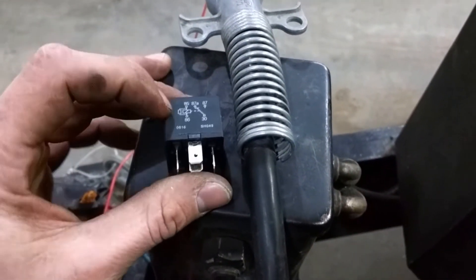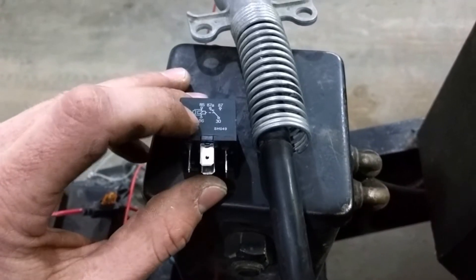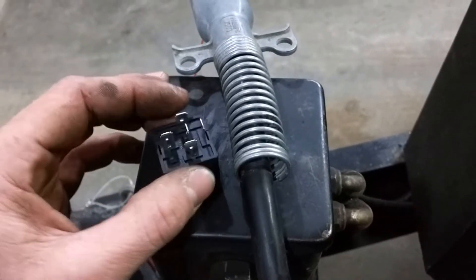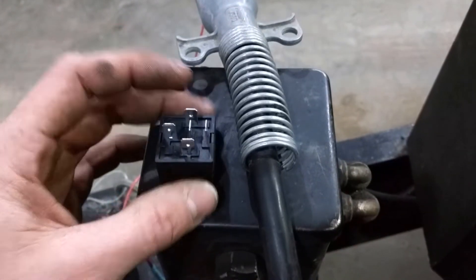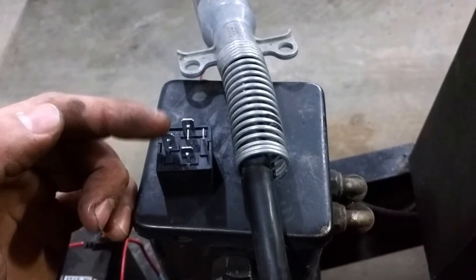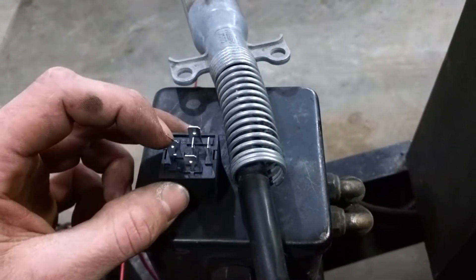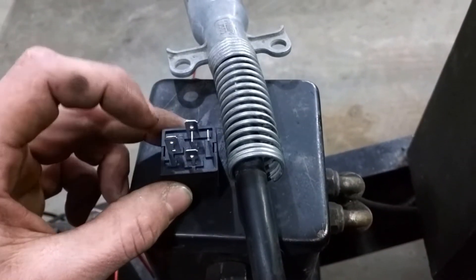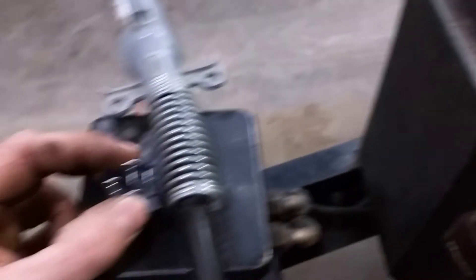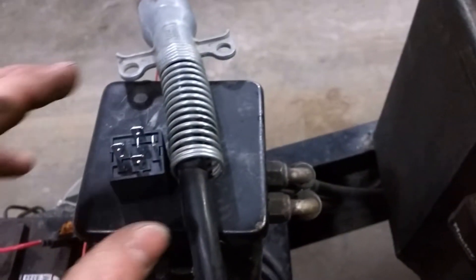The relay has a coil with two wires — one goes to ground, the other gets energized off your pump. When your pump runs, it activates the coil and flips a switch inside. That switch turns the power from your truck to your battery off. Normally, with the coil not energized, power goes straight from the truck to the battery. When the coil activates, it switches over to a test light instead — so if the test light doesn't light up, you have an issue getting juice from your truck.